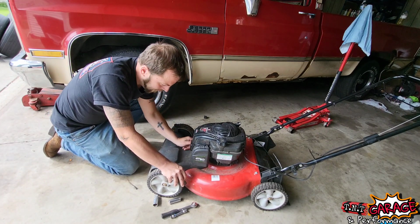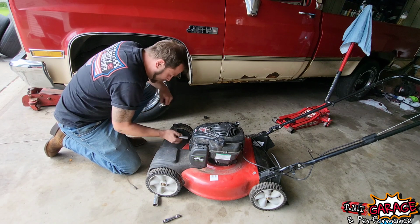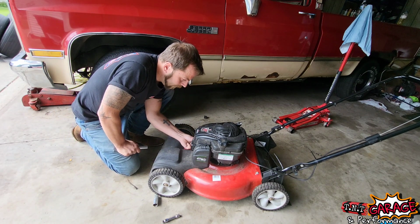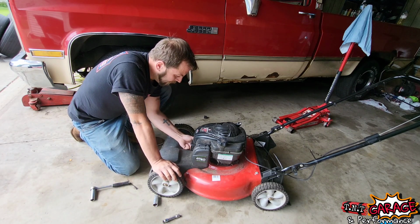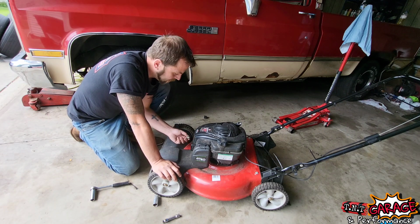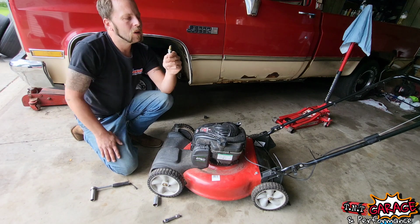All right, let's pull the plug out. What size is that? A 5/8? Yeah. We'll pull the plug out and check, see what we got here. You just basically go through the little stuff, things you can easily check to see why it won't start. It could be a plethora of reasons, but that might be an issue. This plug is soaked, just something fierce.